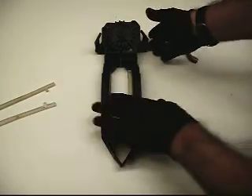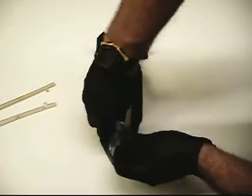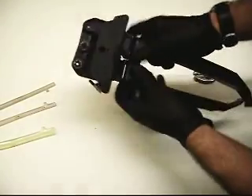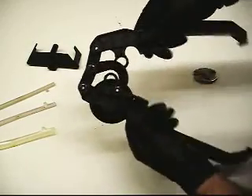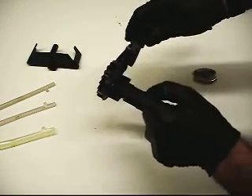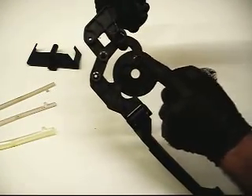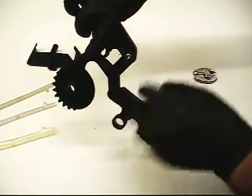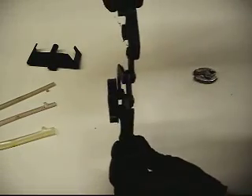You're going to have to either replace, repair, or tune them up. I'm going to show you how I tune all these tongs up. With that damper in there — once I took it out, cleaned all the dampers, and put regular-sized dampers in — it worked fine. But then within a week they all started dropping. I'm going to take this hold plate out — there is now so much slop in each one of these joints. Everywhere there's a press nut: one, two, three on this side and one more on the back side. All that added extra stress has made them loose. See all that wobble?